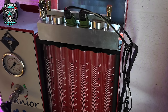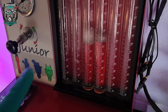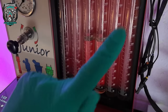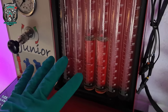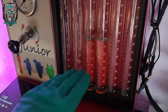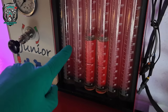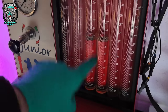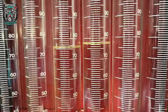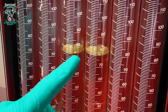Let's go to 100% duty - that's what we need for the flow test. They're supposed to be 285cc injectors. At 3 bar, for 60 seconds, 100% duty - you're feeding the injector with 3 bar of fuel pressure, held permanently open for 60 seconds, and you measure the amount of fuel. This is a 15 second test so the result needs to be multiplied by 4. That one's 75ml, which would be 300cc - slightly over spec, but they're certainly not under-injecting. These eBay injectors are slightly better balanced than the others.